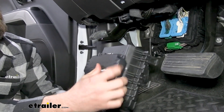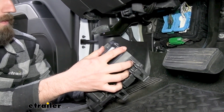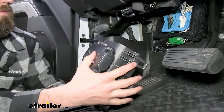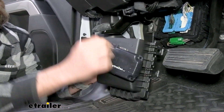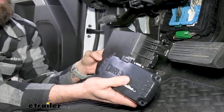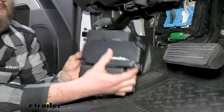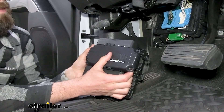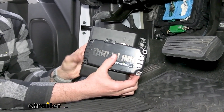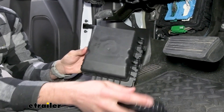It's not really going to match up too well with our holes, so we are going to have to rig this a little bit differently. I'll probably end up zip-tying just one side through. Go ahead and take this off — we're going to drill a couple of holes. Grab yourself a marker so you can mark out exactly where those bracket holes are on your control module.